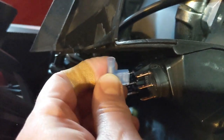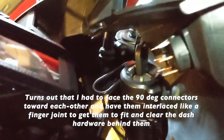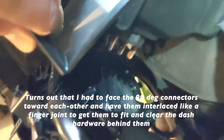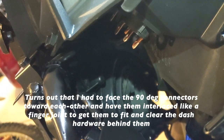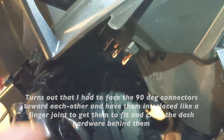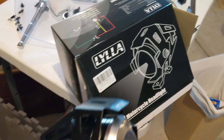For my power switches, I've bought right-angle quarter-inch connectors and these will get pushed on here. I have to decide which direction to run them because when you put this switch back on, there's not a lot of room. I need to choose the wire path — one side for the aux lights switch, the other for the GPS power switch. Both are very low power and I'll be able to toggle them on and off positively even with gloves on.